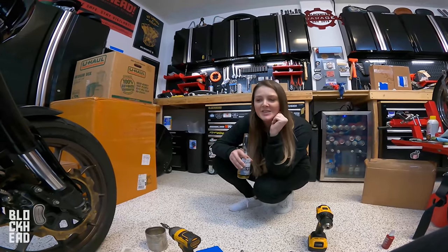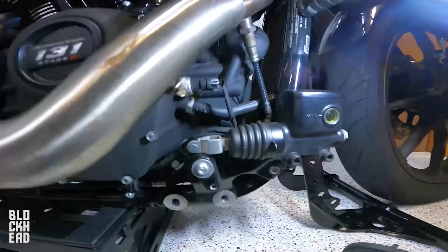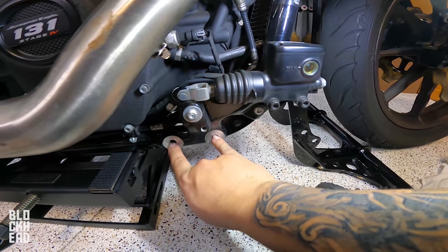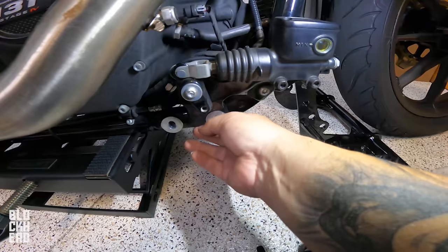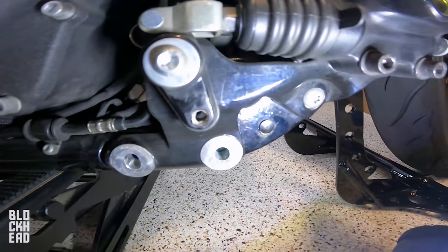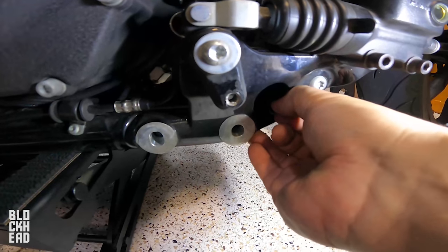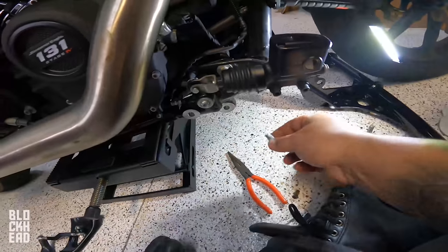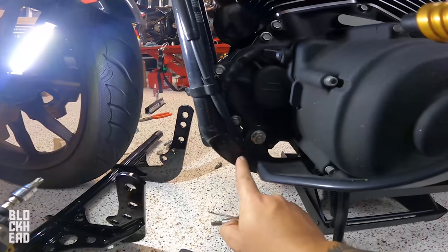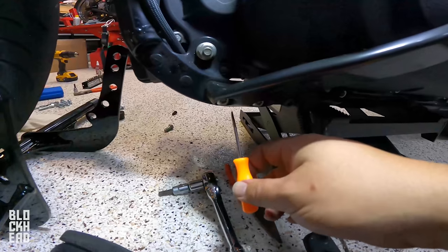It's really impressive that you can just dive in head first and know almost exactly what you're doing — almost exactly, but definitely not exactly — figuring it out as we go. Basically the brake reservoir plus this piece for the foot controls isn't actually part of the frame on the back, it's a piece that fits over the frame. So you loosen up the torx bolt here, then there's also a little cap right here that has just threading under it — we're going to remove that. Got this side prepped and ready, just gotta get the other side done as well. On the left side of the bike we'll remove the foot controls and also these two caps — same as the other side — to access the threading.